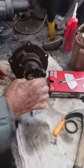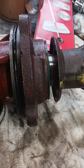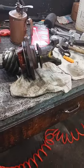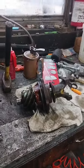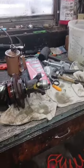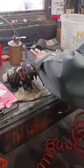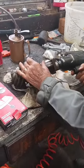Now, we're having a little trouble bringing this yoke all the way down, so we're just going to finish pushing it in with the nut. Yeah, the nut will push it in. I've got the socket and everything, so if we need to, we'll slowly torque, tighten it and then check. They said with the used bearings it should be 15 inch-pounds. I had to grind some. I can tell. You can tell just by doing it, huh? I'll check you too on it. Because it takes a little bit to get the crush washer to start crushing, correct? Yeah, that impact will crush it. Okay, pulled it in.